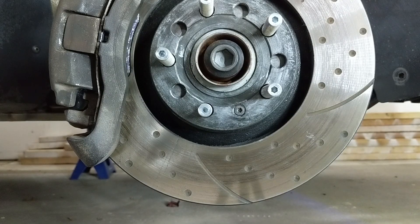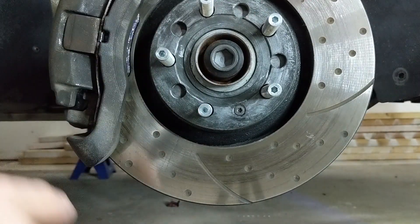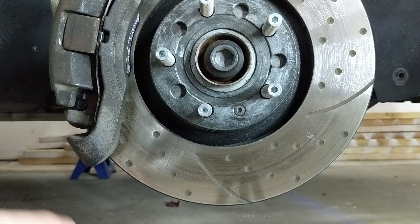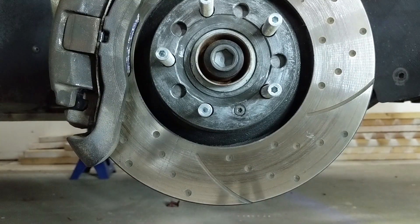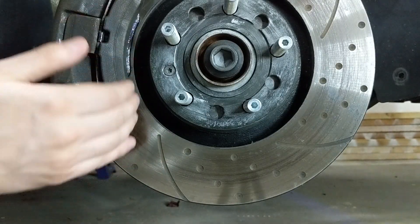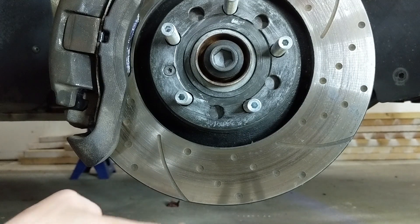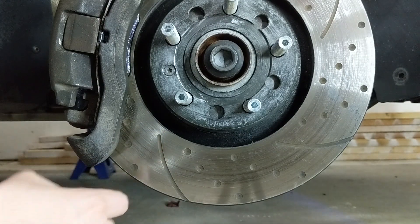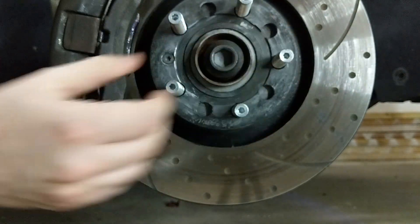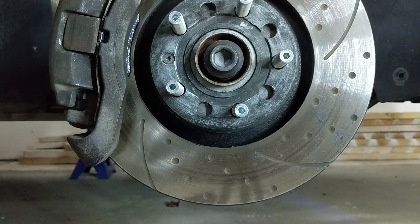The front rotors have been switched over. I also swapped the corresponding brake pads with each rotor onto the other side, since this is a used setup and the pads have been bedded onto their rotors — it's important to send them over as a set. So the illustration of why this reworked scenario might be better: heat, gases, and brake pad deposits slide along the front face of the rotor, fall into the slot, and ride along the back edge, but because the orientation is now reversed, the slot's natural shape drags the deposits down and out the side, ejecting them.